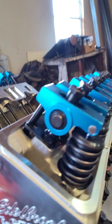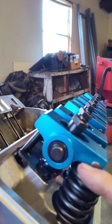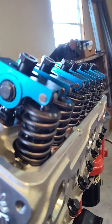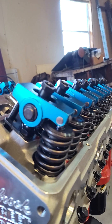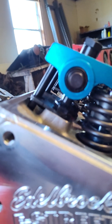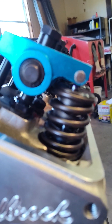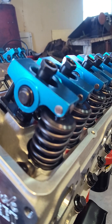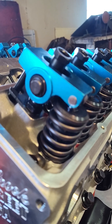Starting from the parallel line parallel to the top of the valve, I went 4.8 turns in — that's half the cam lift — and the idea is that it'll always be at the halfway point of the pivot, so you get the best possible geometry. Straub has a really good video on that and I'd encourage you to go watch it several times, because if you haven't done anything like this before it can be a little intimidating, but he does an excellent job explaining it.